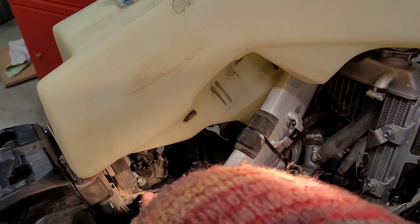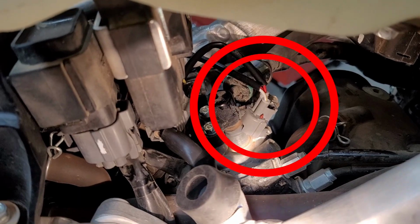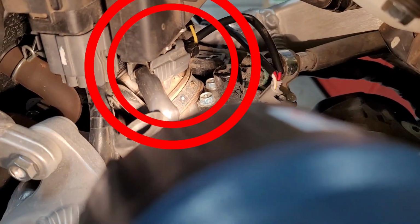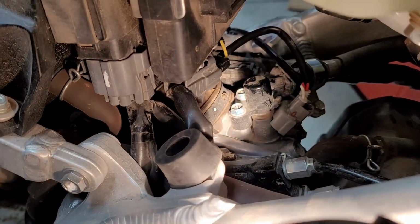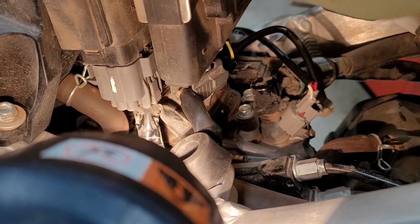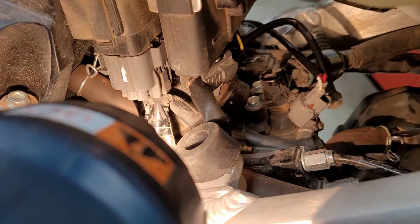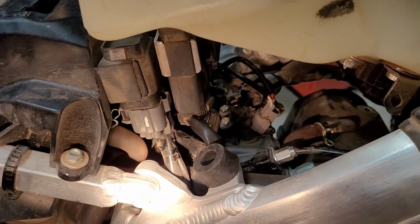That sounds good. As you can see here, let's get some light in there. We've got the pigtail attached into the fuel injector, and then the other side of the pigtail attached to the other side of the wiring harness and the ECU, right there with the light on it. I've tucked everything back in. The injector plug is where it has to be, and the other plug is tucked in right under the ECU. I'm going to zip tie that in, and the cables over there, so that they're not going anywhere. Then we'll lower the fuel tank down and make sure that everything is in good position and isn't pinched.